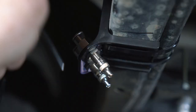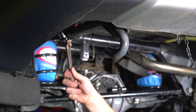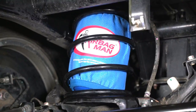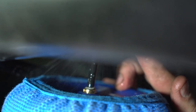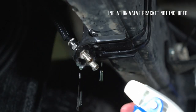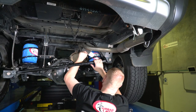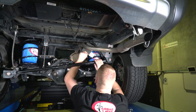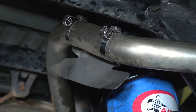Cut the tubing cleanly and insert into the back of the inflation valves. The airbags are inflated and leak tested using soapy water in a spray bottle — the airbag fitting at the top and the inflation valves need to be sprayed. To prevent any heat damage from occurring, simply mount the supplied heat shield in between the exhaust and the airbag, shaping the heat shield around the exhaust to suit.